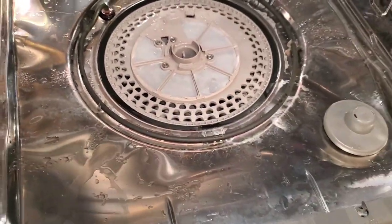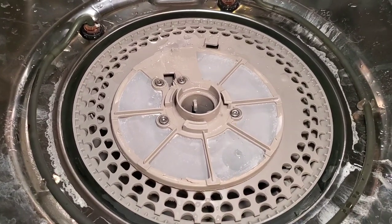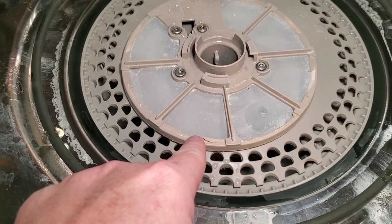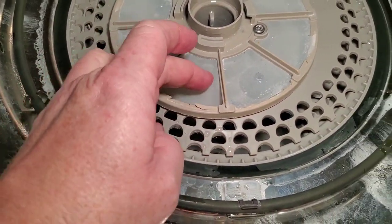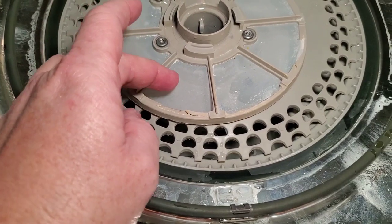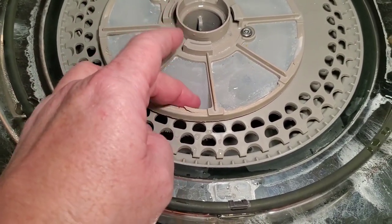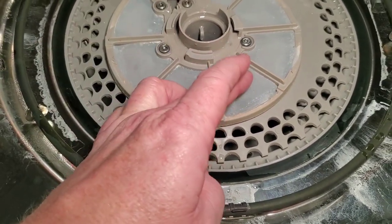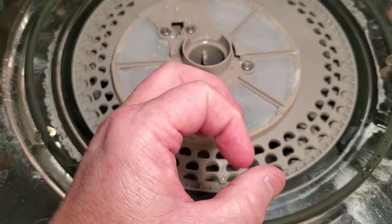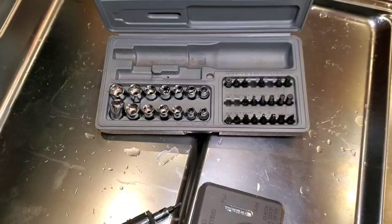Now, this is like a filter but it's very easily damaged, and mine has come loose. This prevents big food chunks from going down into your pump. Mine has become damaged, so I'm starting to get food particles down into the dishwasher pump. It does have a little garbage disposal on it, but it doesn't work very well.